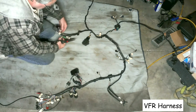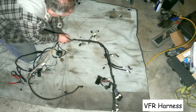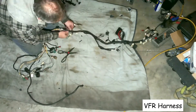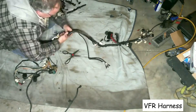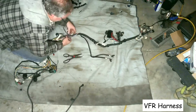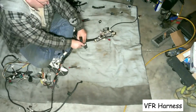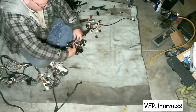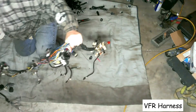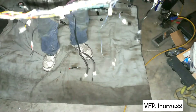I carefully cut about a one-inch slit into the tape wrapped around the wire harness, then unraveled it by hand until I couldn't go further, then cut another slit and continued. I did this all the way up to the fuse box. I decided not to unravel the flashing green wires — those are two of the coil feeds. I reached my first goal: all the insulation has been removed all the way up to the fuse box.